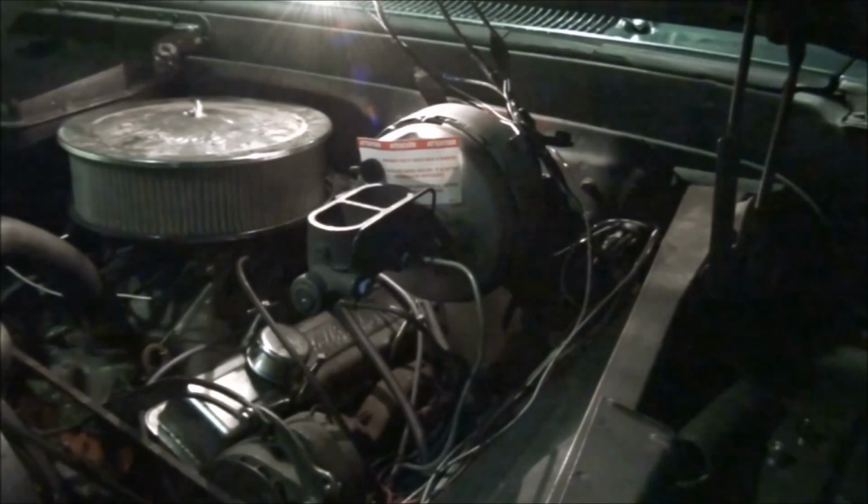And the next thing you do is you put brake fluid in it and you pump the brakes until all the air bubbles quit coming up out of the master cylinder. It's real simple. I'm going to get my vacuum pump out and we'll hook it to this booster. I'm going to use a large screwdriver and show you how to cheat. I may be able to bleed this thing by myself. Actually, you may get to see me bleed it there at the lines. I don't know. We'll find out. But I'm going to hook the vacuum pump to the booster and double check it before I go any further, because I sure don't want to redo the hydraulic system twice.